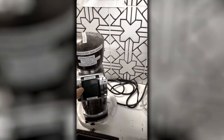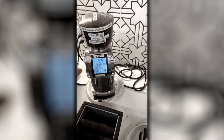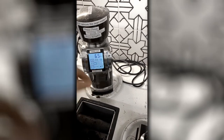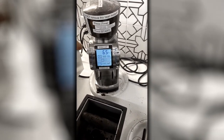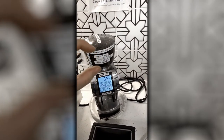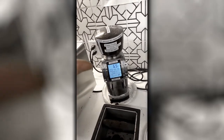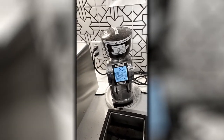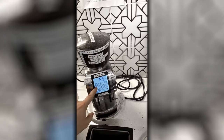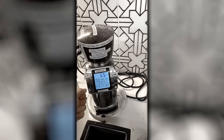PS on the grinder. One thing that's important is that if you do need to change these, don't change it while the grinder is off. Go to manual, start, and let it start grinding, and then slowly adjust these units. What it's doing is changing the distance between the two burr grinders, for very fine or semi-fine. If there's beans in there and you try to push these levers, you'll basically risk bending or jamming the system. So always, if you're going to adjust these, go onto manual, click start, have it start to pour out, and while it's grinding, then make slow adjustments to it.